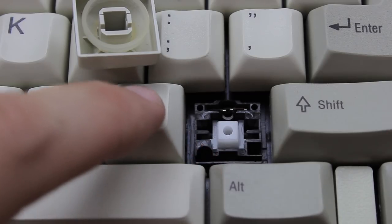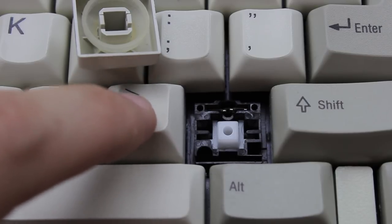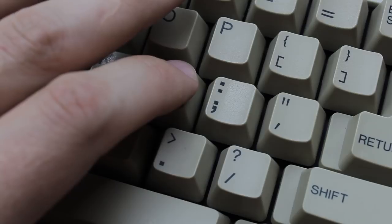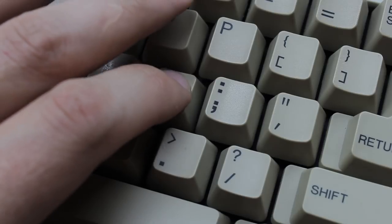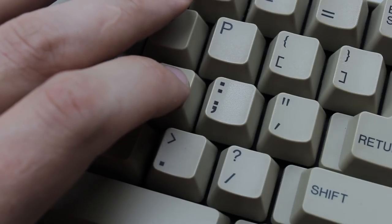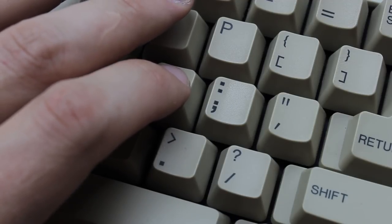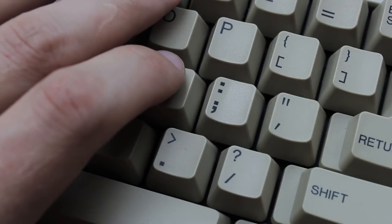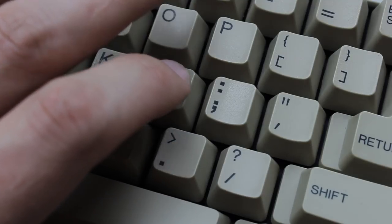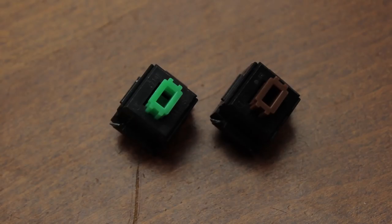The two designs feel very different though: the leaf spring ones feel more sharply tactile, whereas the brown switches have a distinct roundness to the key feel, much like a mechanical rubber dome switch. I found a similar feeling in ITW magnetic valve switches, which also have a very similar extremely rounded feeling — like highly tactile rubber domes except without any of the mushiness. They're quite stiff at 70 grams of actuation force, and despite the tactile drop being only 20 grams and not sharp either, they're still very tactile. Because of the roundedness of the tactile bump, you feel eased into and especially out of it — so it's not super harsh. I think anyone who likes the more heavily weighted Topre variants as well as BKE domes might well like these a lot.